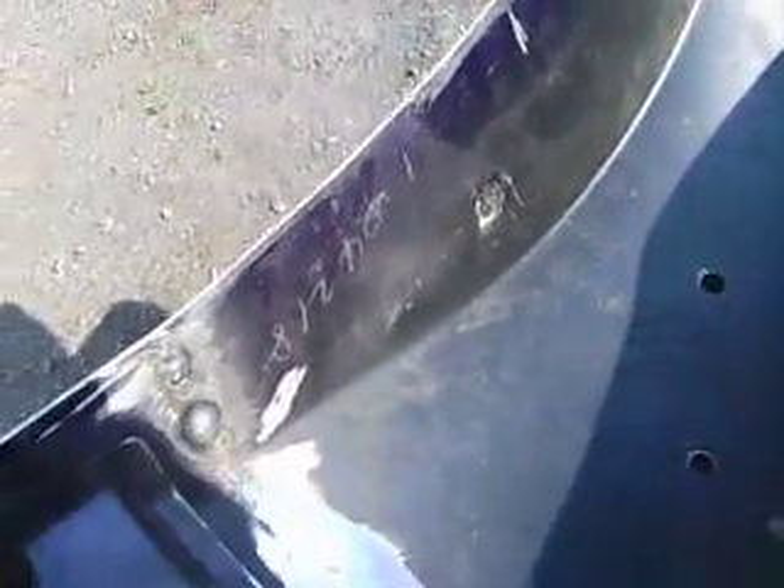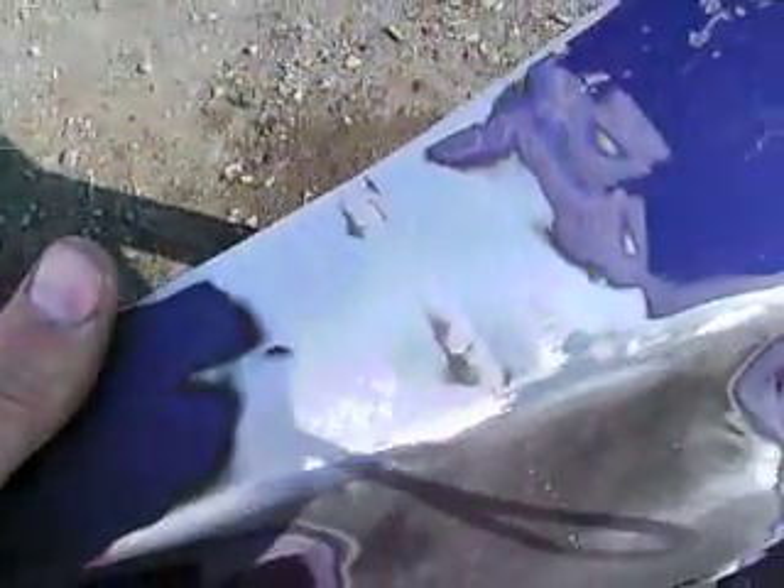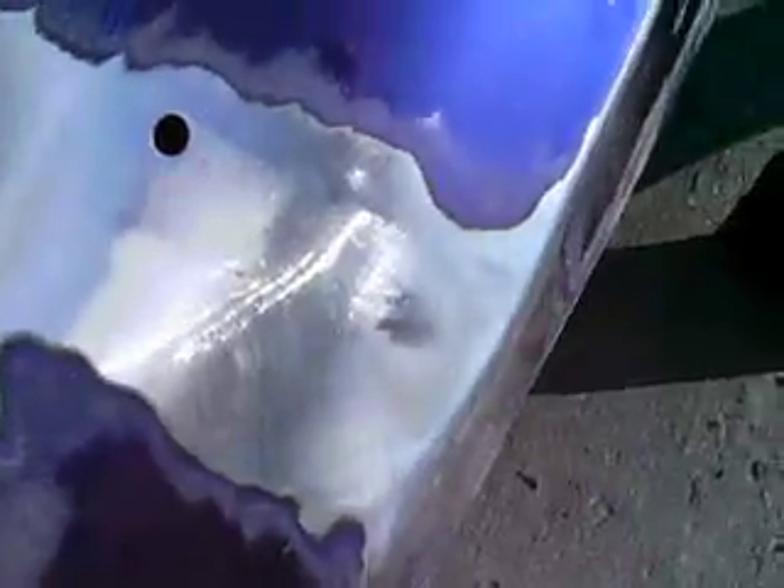You can see where that bead is recreated, and you can see the metalwork where I rejoined the metal from the back side first. You can't do a fast bead all at once or you'll warp the hell out of the metal. Here's a couple of places where it got a little hot. This metal is flat now, and these are just indentations. I'm going to lightly skim this with body filler, probably most of it will be so thin you can almost see through it. Especially the top part here — other than a few pits, this is just about perfect.